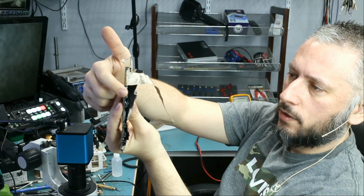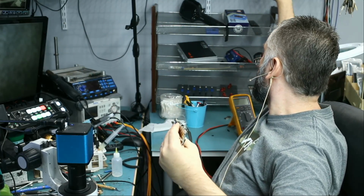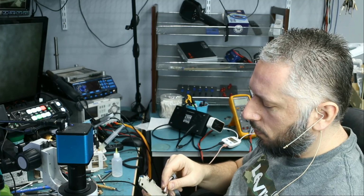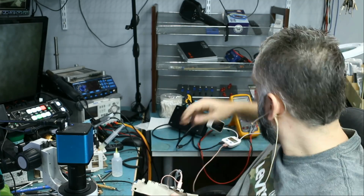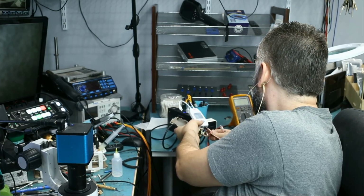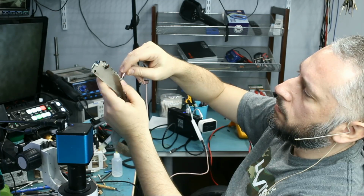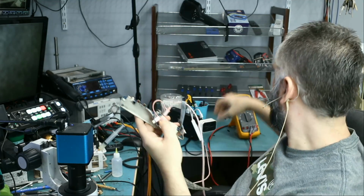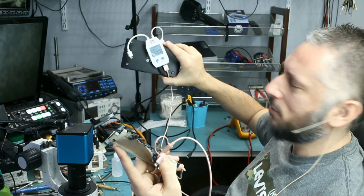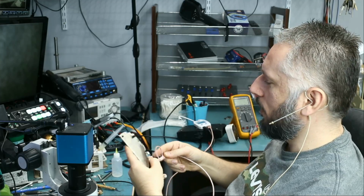We changed this charging port right here, the one on the far end. And I do not know if we can tell if the port is working or not without having to plug this in the monitor. The meter may show 0.01, 0.02, or whatever the case may be, but we should be able to tell if that port is good. Okay, so let's plug the cable backwards. And look at this, 0.12, which means that the port is working and the motherboard, without being connected, is drawing a tiny bit of amperage, 0.12, and that's awesome. So I'm gonna give it to Big Boss to reassemble and test.